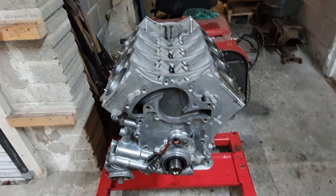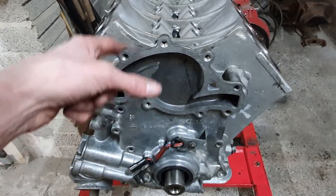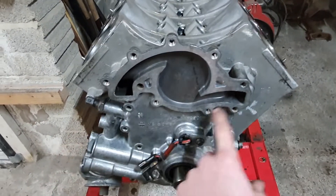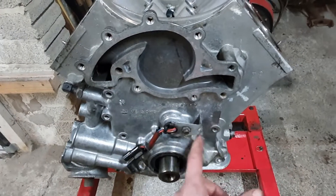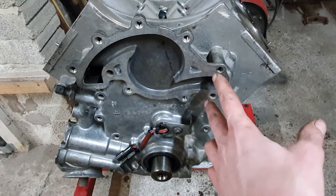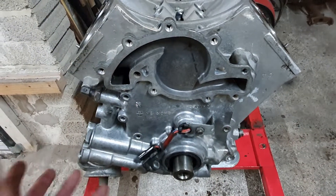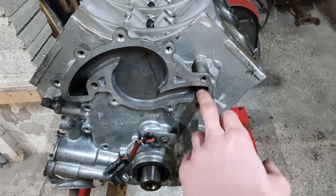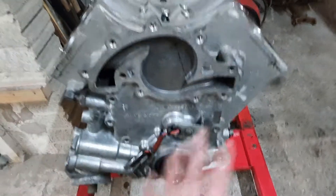I've got to go cook dinner now but when I come back you'll see in the time-lapse. I'm going to put sealant around the back - obviously there's no gasket in here yet. There's a gasket to go in with sealant, and I'll put another one here with sealant as well. There are a lot of bolts here which hold it, but there are also bolts which go through the water pump and hold it. So I don't want to tighten this thing up and leave it overnight without those ones in - I wanted it assembled as one and then all those bolt torques can be tight. This is quite critical: you wouldn't want a leak between the water and the oil if a leak occurs inside of this cover. So I want to do all of that - water pump and cover - all as one.